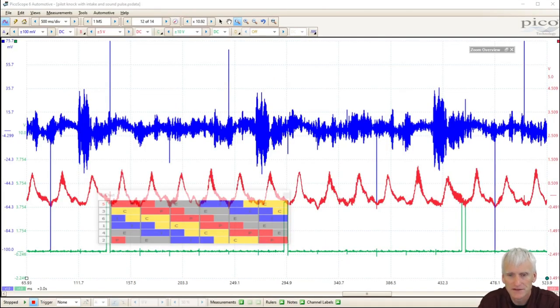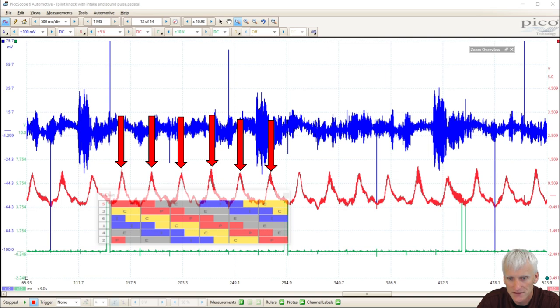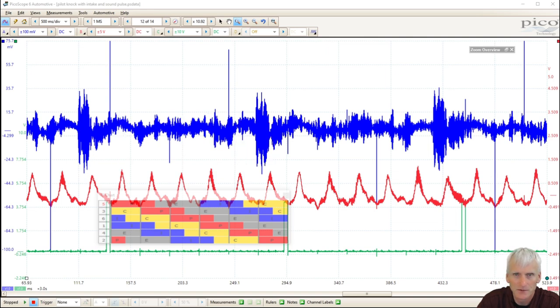This here is that same Honda engine tick, but I went ahead and threw on the intake pulses just for good measure to see if anything would surface or show up. And you can see with these intake pulses, they look pretty even, pretty consistent. And I really wasn't expecting to see anything. This thing did not have a drivability problem. It just had noise. So I was just putting this on there.